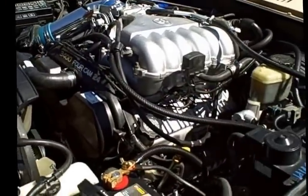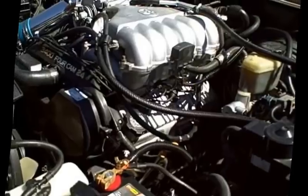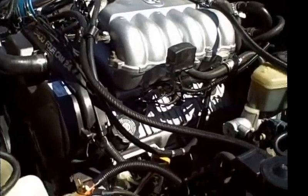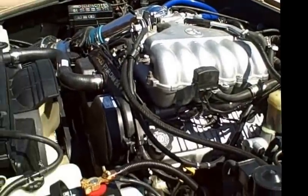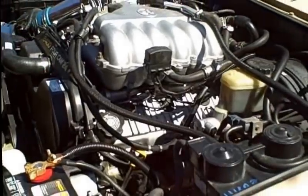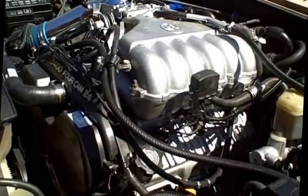Okay, once again, since you have no idea who owned your engine previously, I have a suggestion that could very well clean out the internals of your engine and cause it to run a lot better, with better compression and so on. On your first startup, chances are when it was shipped it did not come with any oil in it, which is cool. Just slap on an oil filter, a cheapo one, put some cheap oil in there, 5 quarts, and add 1 quart of ATF to it.